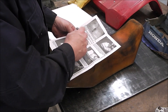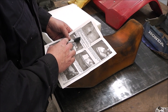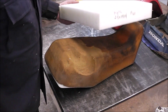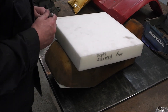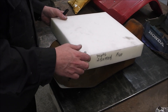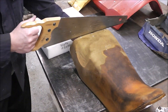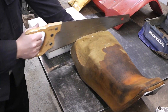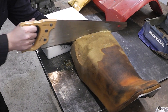This seat cover came with some directions. You need quilting batting, an electric carving knife - but I don't have one - some 2-inch high density foam, and some contact cement. I'm going to use this as a straight edge reference. We'll cut along that line to get rid of the little bad spot. All I'm using is a wood cutting saw, and this couldn't have worked any better - it was super easy and accurate. When you're trying to patch in this foam, you want to make nice, straight, square cuts.